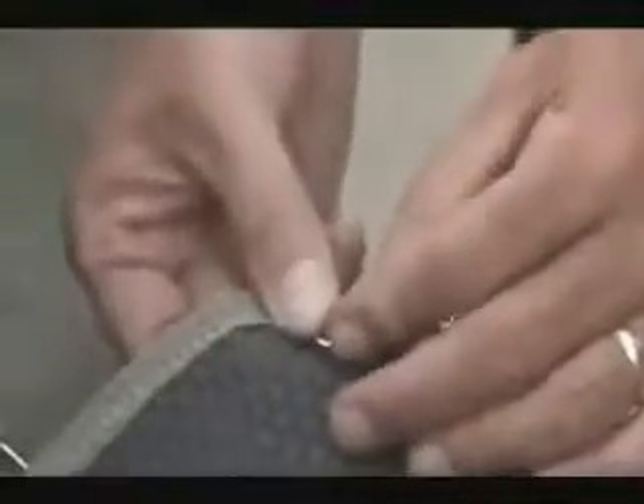The cap part of the snap is through the carpeting. Take the snap portion of it, put it over the barrel end, and get ready to do the installation. The installation of the snap is done with this base, which holds the cap portion of the snap, and the setting tool. One end of the tool is going to go right down in and peen over the inside edge of the barrel. Make sure the snap is good and secure, and you're ready to install it.